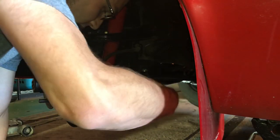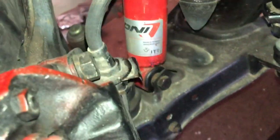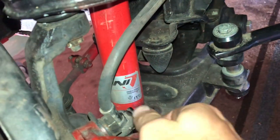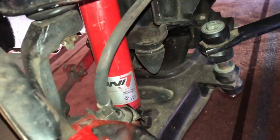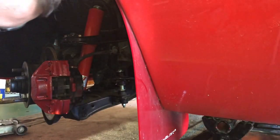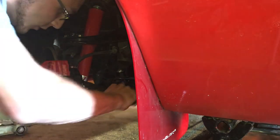So what I'm doing now — there's a soft brake line right here, and here's a clip that holds it on. By taking that off, I'll get myself some wiggle room and maybe be able to get this line out of there easier. So take a pair of pliers, grab at the end of that, and it'll just wiggle out.